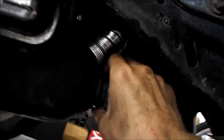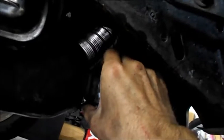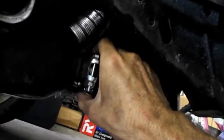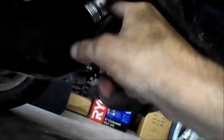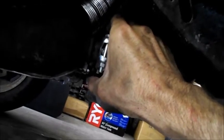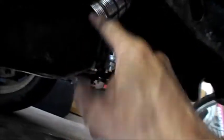Well, I can tell you just by putting my hand up here — okay, there's significantly less. I think to do the test properly I've got to disconnect the fan belt. There are leaks coming around here now that I've got my tubes fired up. There's air coming down these tubes and it's leaking right around in here, so some of what's going on is just general leaking, but I don't feel puffing. The puffing will be the exhaust — I just feel a general blowing, and that is coming from this.